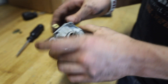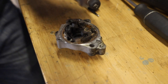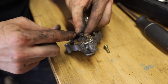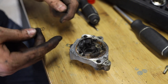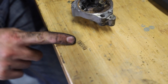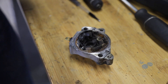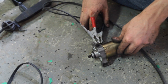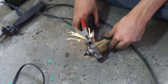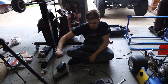Alright, so what do you want to do? Try to sand it? I'm just going to, for the heck of it, try and clean it up, but we're probably just going to order a new one. The brushes are super worn, but there is some left, so it probably should still work. I got them both unseized — very greasy in there. We got one spring, but on the other side there was none to be found — I found like one coil and that's about it. So I just took a pen spring and cut it down to size, and hopefully that'll work. Pen spring's where it's at!